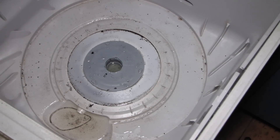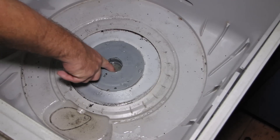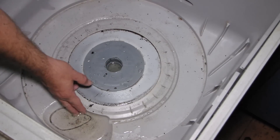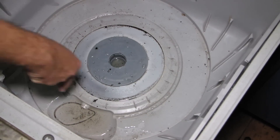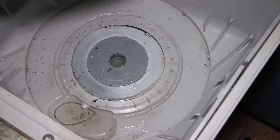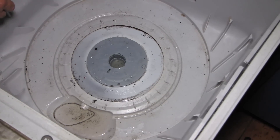I think what happened was a bit of debris got into this channel, restricting the water flow. The dishwasher was running the pump to empty it, but only runs it for so long — the restriction meant the pump wasn't running long enough to empty the water. Clearing the channel fixed it. Hopefully I've shown you how to fix a blocked channel and how to replace the rotor. Thank you.